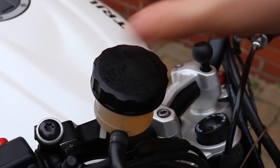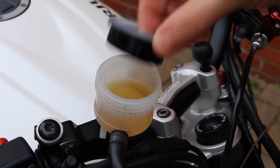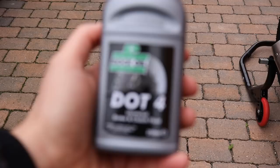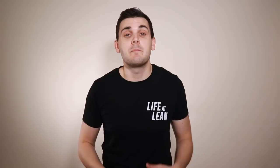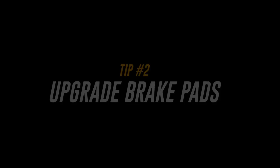Up first: refresh your fluid. This is the cheapest and most simple way to improve the performance of your brakes. If your fluid hasn't been changed for a long time, I would recommend you make that the first thing you do. Glycol-based brake fluid — that's DOT4 fluid — is hygroscopic, which means the fluid itself will absorb moisture even in a sealed system. Over time, you'll get a buildup of water in that system which will decrease the performance capabilities of that fluid. Changing your fluid regularly is very important for keeping it fresh and, in turn, helping keep the performance of the braking system as high as it can be.